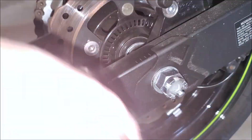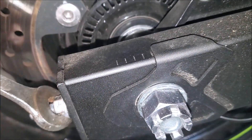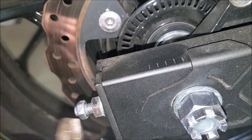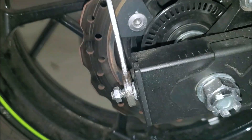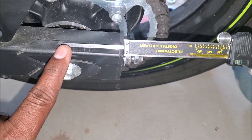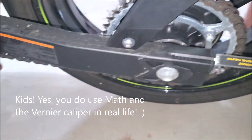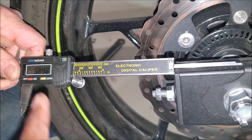Going the right way — yes. Five more turns... yeah, that looks about right. One, two, three, four — I'm a little bit looser, so I'll get the calipers out. To be super precise, measure one side with the proper meter: we got 58.99, which is basically 59 millimeters. The chain is in the right tension, and we'll match it on the other side. We got it very precise — 58.99 on this side as well.